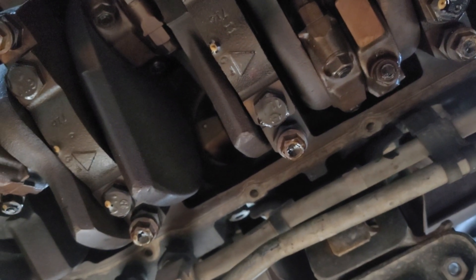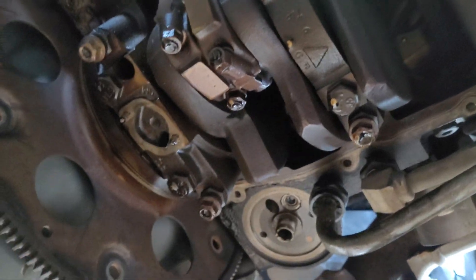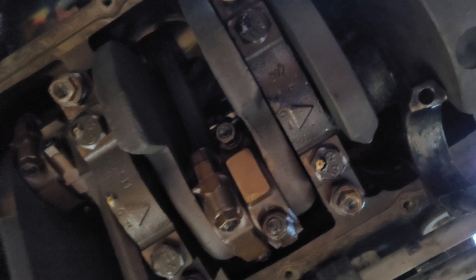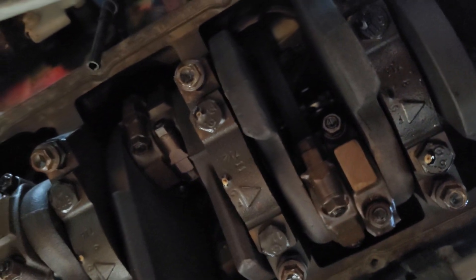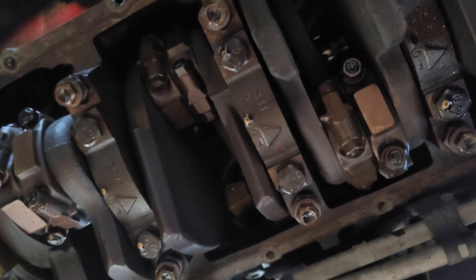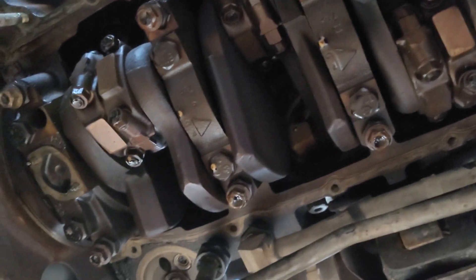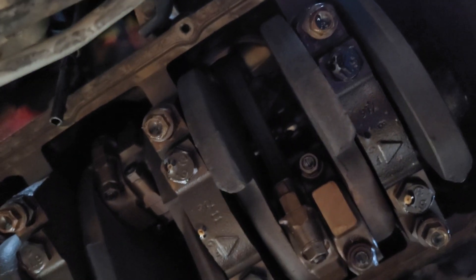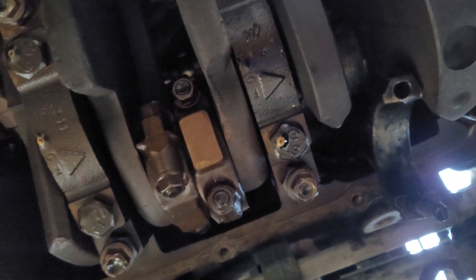The reason this happened — and if you're looking in here you'll see how clean everything is — straight up, they just ran it out of oil. The one thing about these big block Chevys is that they do use oil; they'll use about a quart every 1,000 miles. So whoever was the current owner just did not bother to check it for oil, and they ran it out. So they dropped that rod, ruined it.